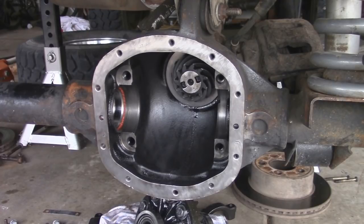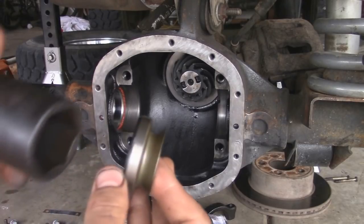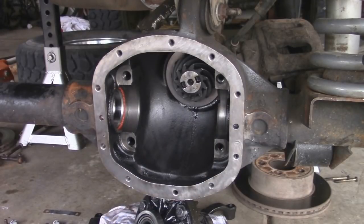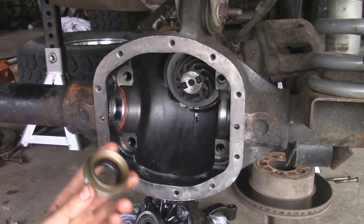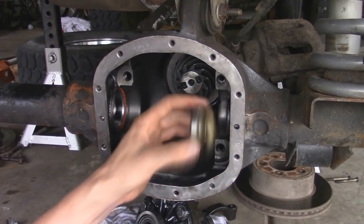So now we can go ahead and install our new seals. I'm going to make sure the seal is all lubed up on the sides as well as on the inside. You can't really use a standard seal driver kit for this, so what I'm going to do is take a 36mm socket — it's going to sit right in here — and I'll take a bunch of half-inch extensions and hook it up to the 36mm socket so I can hammer it into place. I'm going to put some oil in and then set the seal. The flange side is going to be facing towards the tire.